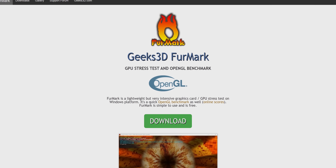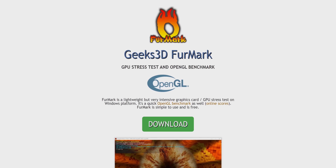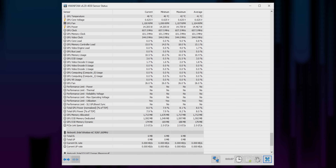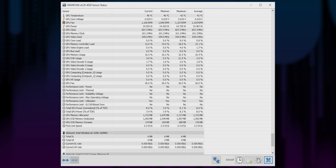Now, for the moment of truth. Our stress test was designed to hit both the CPU and graphics card with FurMark, while logging all the pertinent data using HWiNFO. That means not just temperatures, but also power consumption and clock speeds. In each scenario, the system was allowed to hit a steady state, and then we stopped the loads and let the system cool back down to our idle temperatures.